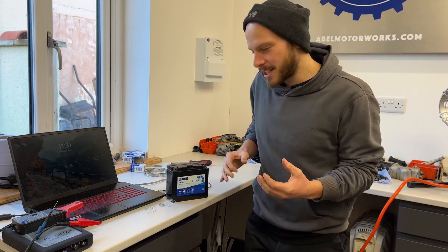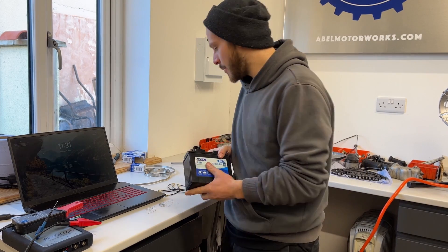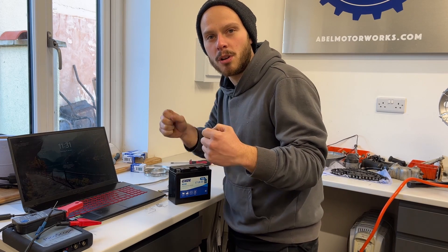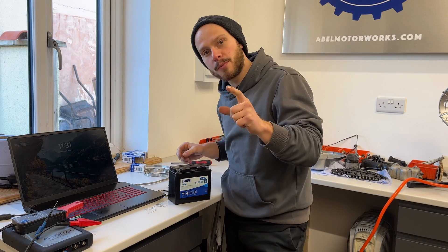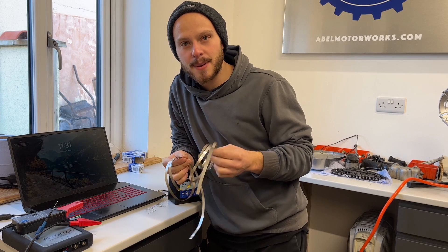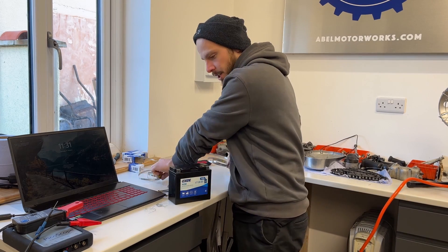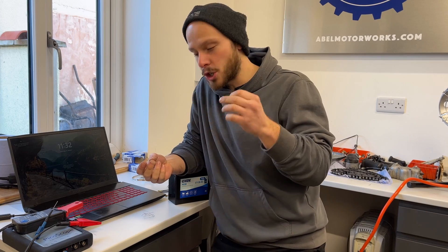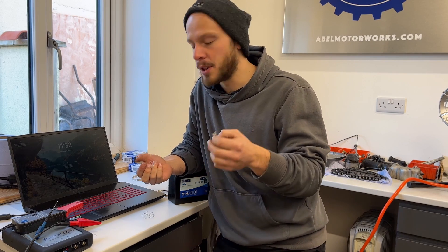So what am I actually trying to do here? I'm going to make a 12 volt circuit with some H7 bulbs to get the 15 amp draw that I need to replicate what a cell is going to discharge at its max output. I can test different nickel strips to make sure they don't get hot at 15 amps, and also test fuse wire of different sizes and thicknesses — which one won't get hot at 15 amps, and also which will break soon after for the most efficient fusing.